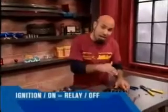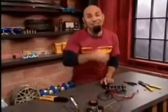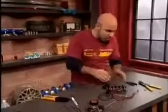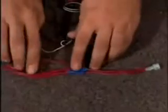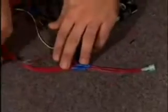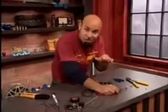Now follow me here. Ignition on, relay off. No ground to the control unit means there's no way your doors are going to accidentally open while you're screaming down the drag strip. Got it? Good. All right. Once you have your safety relay put into place, you want to combine all of your positive leads and put a spade connector on the end. Then, you want to pop an eyelet connector onto your ground, clean up all this mess of wires, and take the unit over to the car.